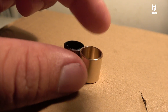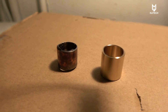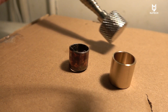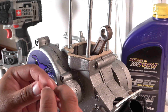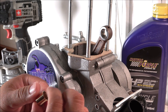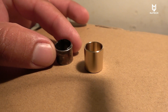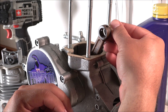If you look at the old one, you can see it came together but it looks cheap and is not well made. There's a big difference between both. The inner size of the new bushing is 12 millimeters, the outer is 14 millimeters — or maybe a little wider, possibly 15 or 16 millimeters — but it still fits on here.